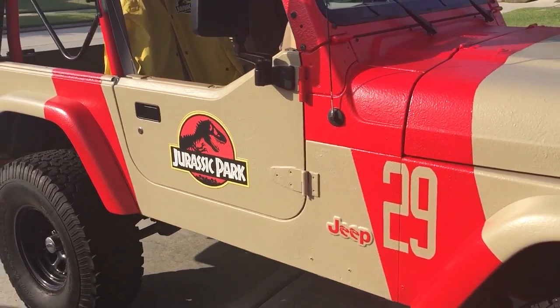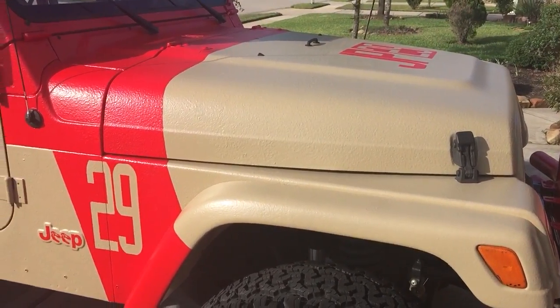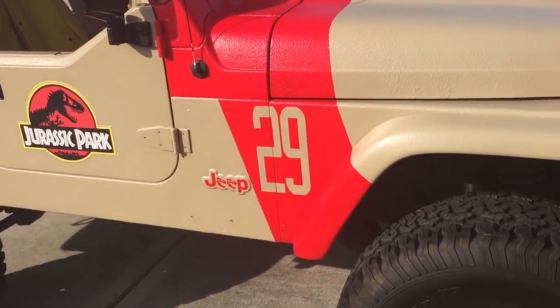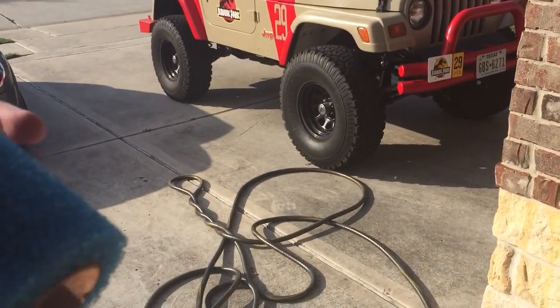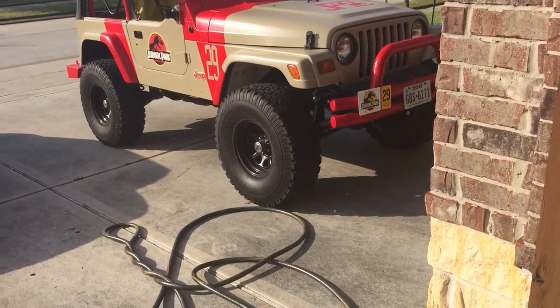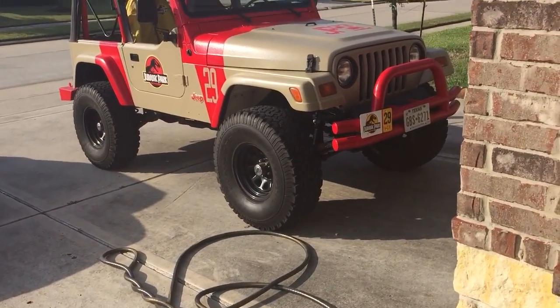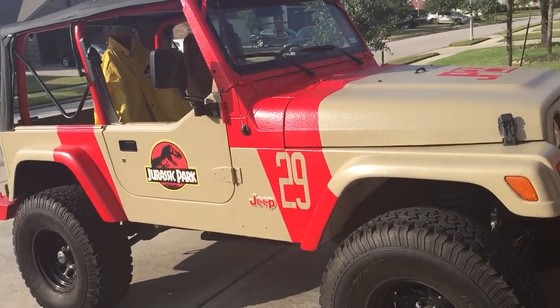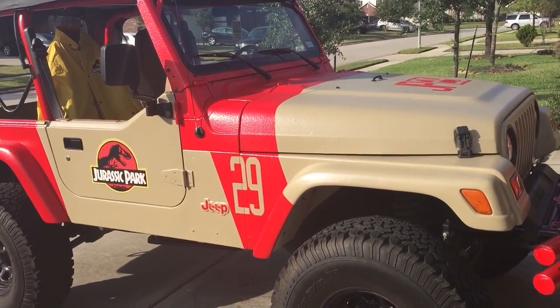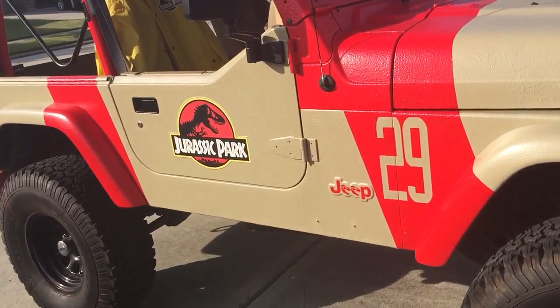The texture of it is very easy to get really consistent, and you don't have weird runs or lines or obvious places where your roller went. It's because on these rollers, when you roll the material across, it really wants to pick that texture up and make it kind of gnarly. Then once it's set for a minute, the liquidy part of it will settle. It really hides those lines because the material is not left exactly like you touched it with a roller. It's going to settle a little bit because of the liquid nature anyway. So it made it really, really easy.